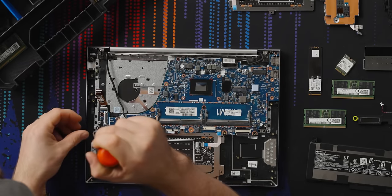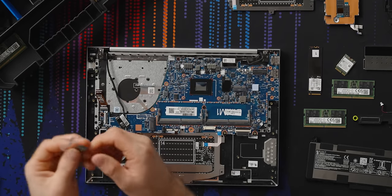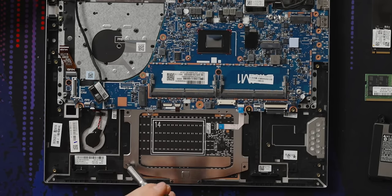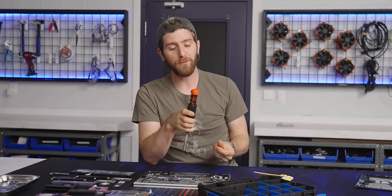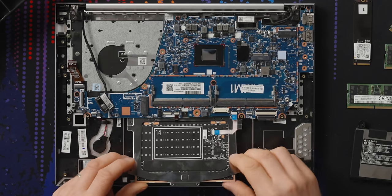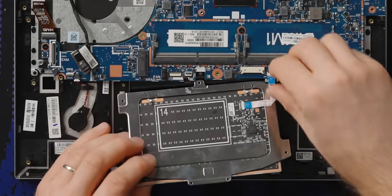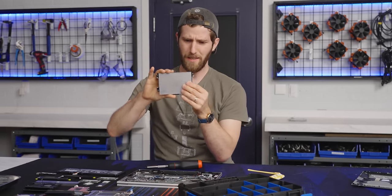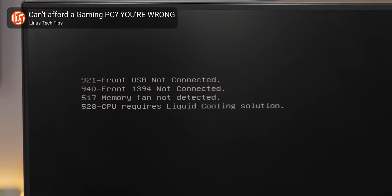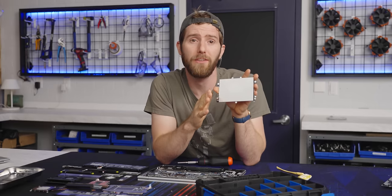The fingerprint sensor comes out easily — just pull it out. The real-time clock battery uses no screws at all. The touchpad has just seven screws around the perimeter — we finally had to change to a Phillips zero bit for these very small screws. The touchpad is a little tricky because the cable is adhered to it, but it's not permanent adhesive. Now that the touchpad's out, we can see it's got a glass surface and it's massive.